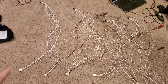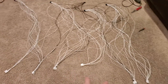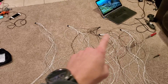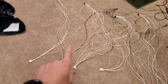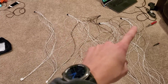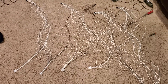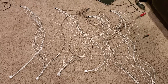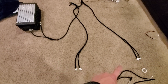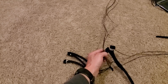This is how it works out: we've got essentially two plugs for each battery module — module one, two, and three — and then one plug for each BMS. There are 12 leads here, 16 leads here, 12 leads there. Some of those go to one BMS, some to another. Four modules gives you 48, and three modules also gives 48. Those are the thermistors right there. Let me bundle these up somewhat tidy. Got them all cleaned up — there's one set for module one, module two, module three. And up here we've got BMS one, two, three, and four.